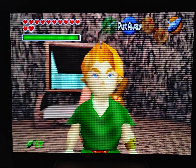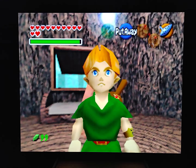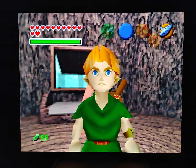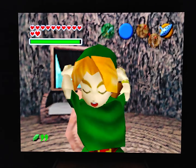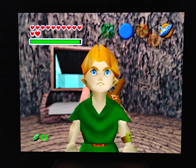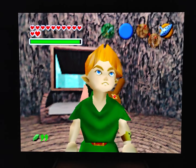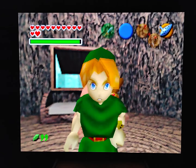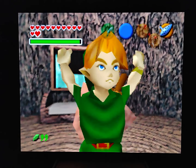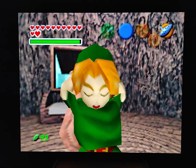This is my custom profile, and I'm now going to switch to the default profile just so you can see the difference. There's the default profile — you may notice it's a little brighter and zoomed out a bit. I don't know how well the CRT mask shows up on YouTube, but basically right now there's no mask — you have a lot of really sharp pixels. If that's the look you like, that's totally fine. I recommend using auto phase and auto gain for analog sources.